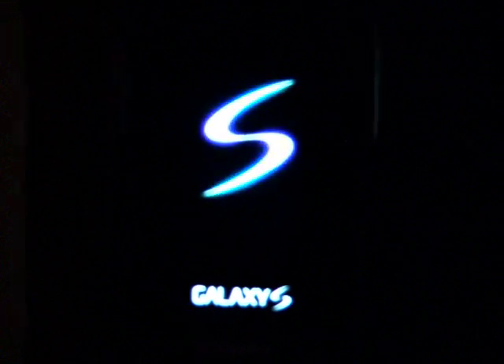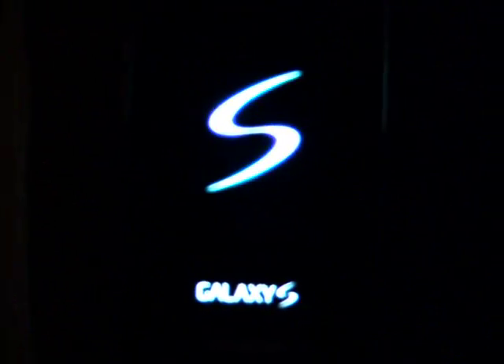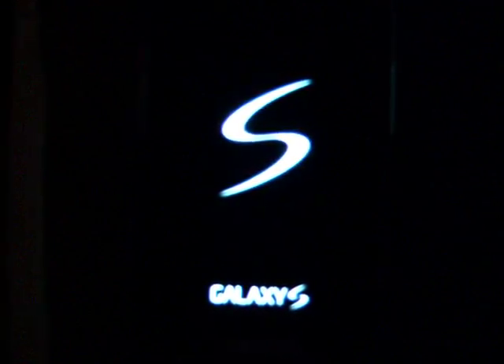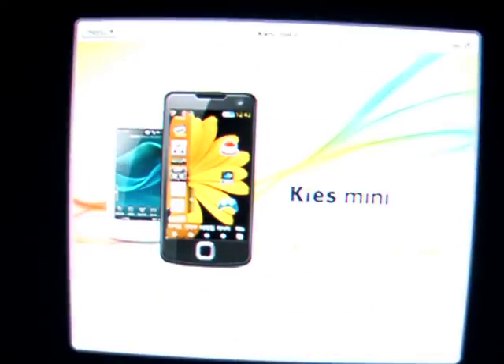You can see that you have to be patient. Oftentimes what people do is they think something's wrong during this process, where the phone is actually installing the update patches and upgrades. And so they start disconnecting cables. If you're in this process, you're fine disconnecting the cable. But if you're connected when it's actually downloading files to your phone, you can get in a lot of trouble — you can brick your phone that way.